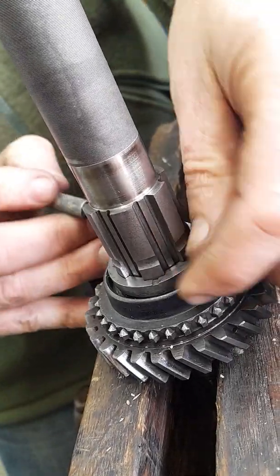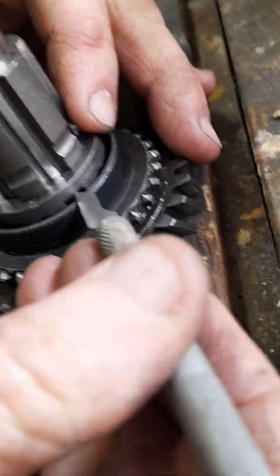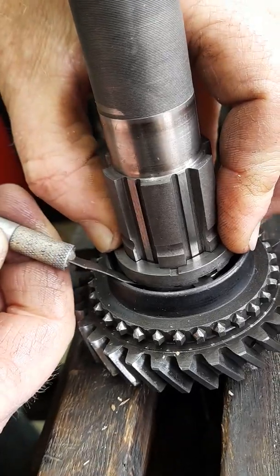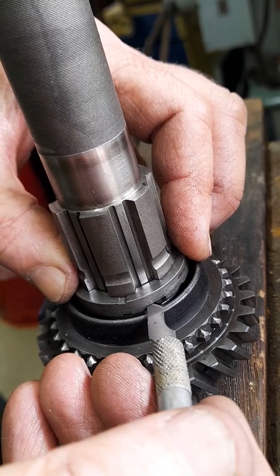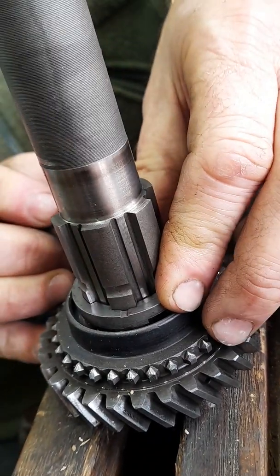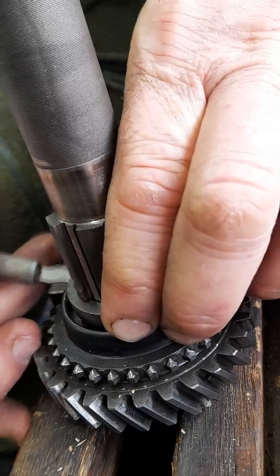I think it's this side that's sticking. You can see there, hopefully, if you're having trouble, that's where you get your knife in. You can't get it in here. If you try and put it in over the side here, you just can't get one in. It has to go in through the slot which holds the half washers in place. That one's stuck there for some reason.